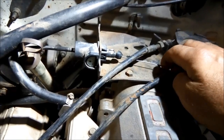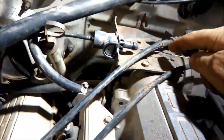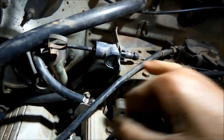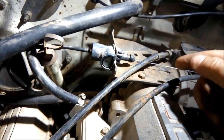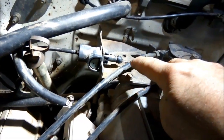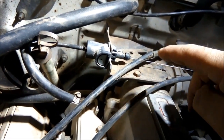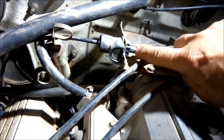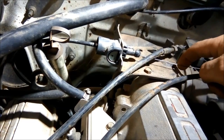You can see that the cable is still a little bit loose. These cables have a ratio, which is basically the ratio between the outer cable and the inner cable. You can adjust it by just pressing this little clip here, and by increasing the pressure you're actually making the inner cable tighter, or the distance between the inner and outer cable longer. If you want to back it off, you bring them back together. So I'm just going to press this and slide it out until this cable is just fairly tight.